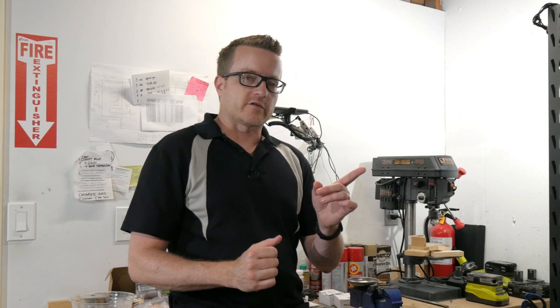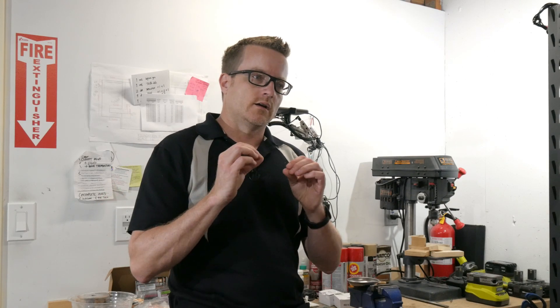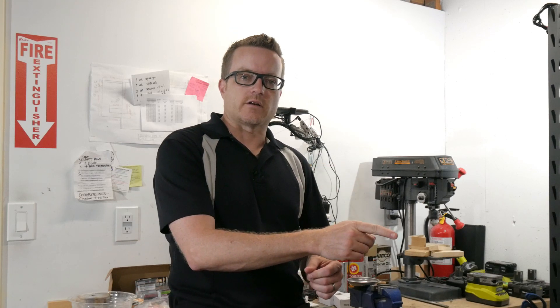Hey everyone, thanks for joining us again on another episode of Workshop Quick Takes, hopefully you found that helpful. There's a problem you can go solve in your vehicle, and I guarantee it's there whether or not it is causing problems yet. Problems like this can also implicate the door harness — we have a previous video on that, link in the description. Also, shared grounds: on the 97-01 you have your main body fuse panel down inside the kick panel by the passenger door, and a lot of circuits are made up there, and there are also some shared grounds in that area. Especially if you have two circuits that seem to be interacting with each other when there's no explanation why, a lot of times it's probably a shared ground and a bad connection, especially on older vehicles that are going rusty. We did talk about soldering with lead today — just make sure you wash your hands thoroughly, and try not to scatter any debris you create when you desolder around into the environment. Just get it into one trash can and dispose of it; it won't cause any problems after that.